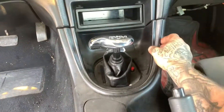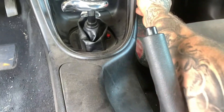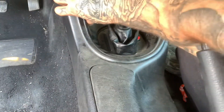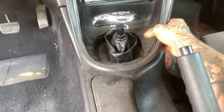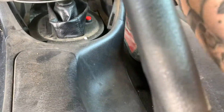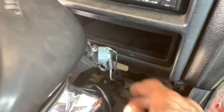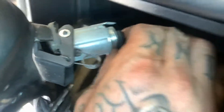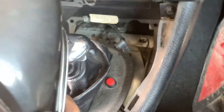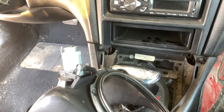While you're at it, you can ditch your console bezel — you're going to need it out regardless. You do that just by pulling up on the sides; it's got a clip in there and it pops out. There is one ground wire under here to the lighter — you just pull this little clip off. Then on the back there's a rubber one on an all-thread. For both the automatic and manual bezel they're both the same and that's how you remove it.